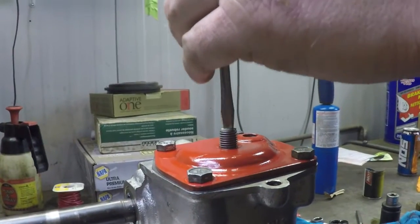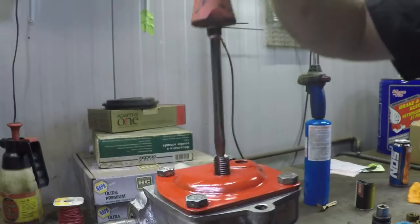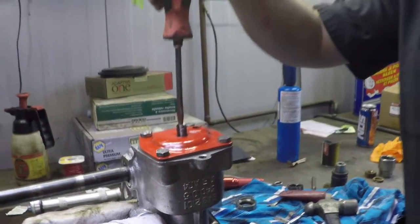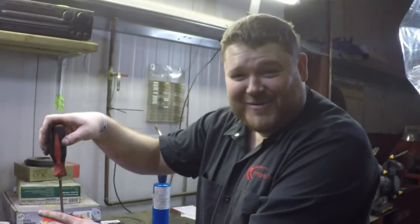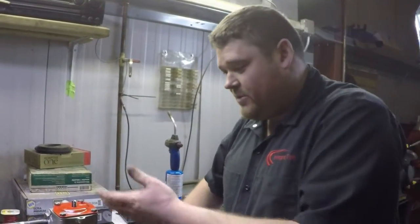So we were sitting there, we'll back it off one half, and this is gonna sound really bad, I like a tight box better than a loose box, at least when we're dealing with a steering box. So I'll go half a turn instead of a three quarter turn. If you go three quarter turn, you'll have a little more play, but it'll be a little more pleasant. I'd rather be a little more firm.